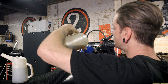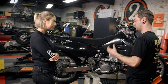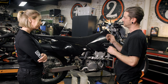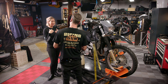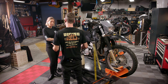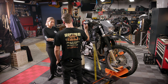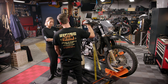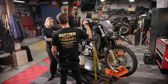So is there anything else after you've filled it up? The last check to do is to cycle the new oil through the bike. So we're going to run the bike again for another couple of minutes just to warm it up and then we're going to check the level on the dipstick. Does it matter if you only have a side stand when you're doing your oil? It does make a difference but it doesn't necessarily matter. If you just leave it for a little bit longer and your bike is warm the oil will eventually drain out. One thing to note is you can hold it on one side, bring it up off its side stand, and just give it a light shake — that should drop some of the excess oil.